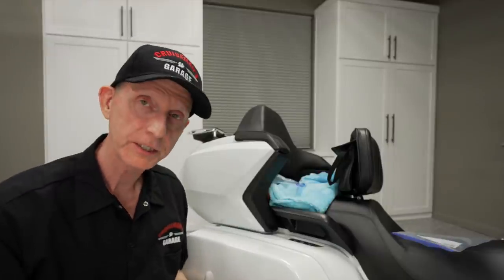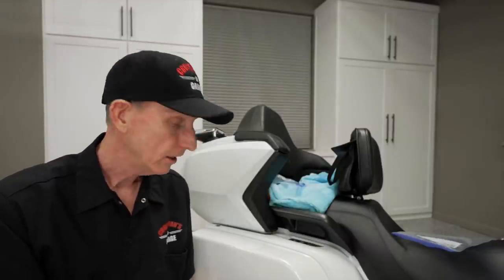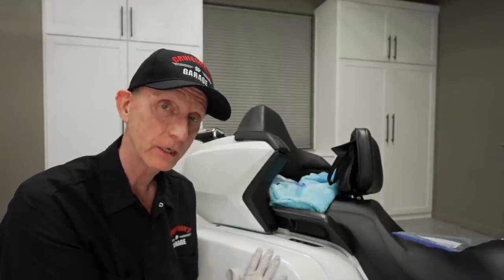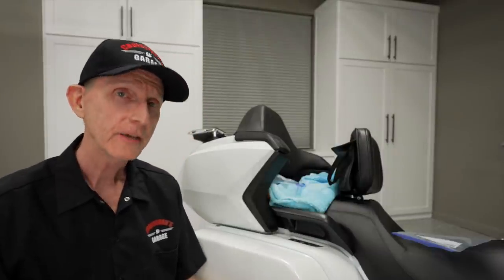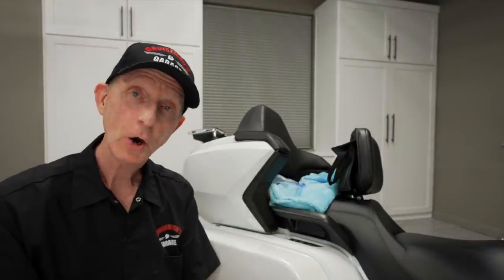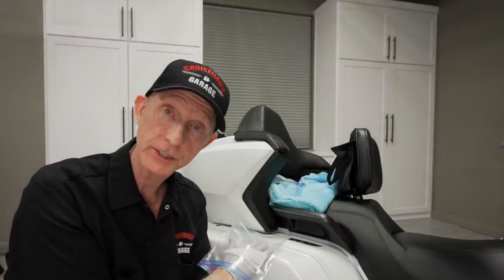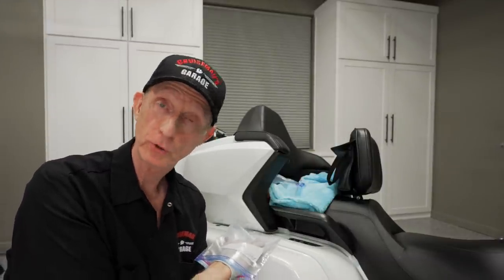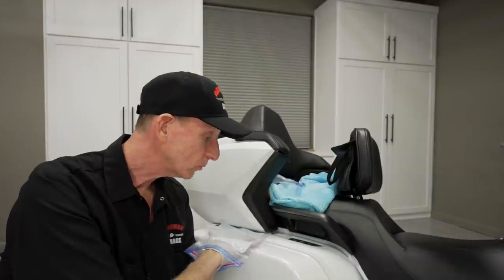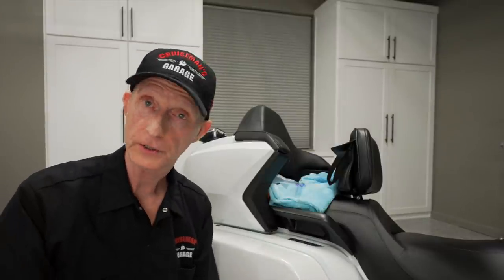Your motorcycle is exposed to contaminants in the environment and brake dust coming from your brake pads. You can't necessarily see or feel those with your naked eye or even with your hand. But there is one simple test you can do to see if you have contamination on your paint: use a simple Ziploc bag, slip it over your hand, and run that bag across the surface of the paint. You'll be amazed — in most cases you will feel some grittiness that you did not feel with your bare hands. That Ziploc bag will allow you to feel that grit — those are the contaminants in the clear coat that we're going to remove using the clay bar.